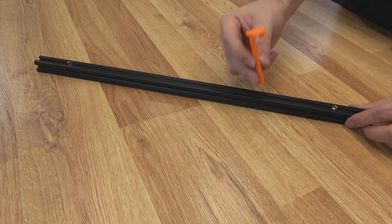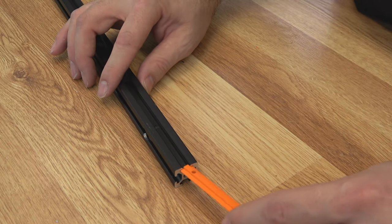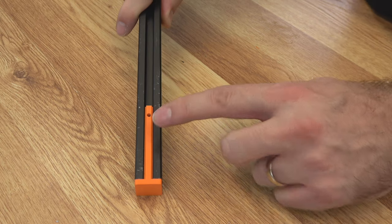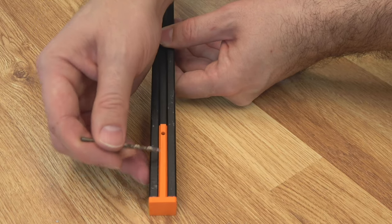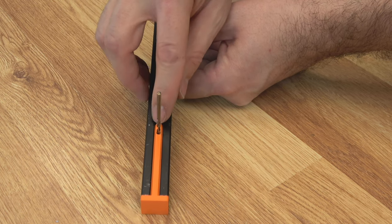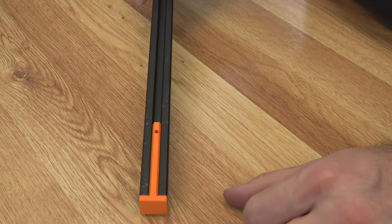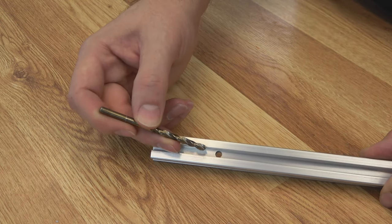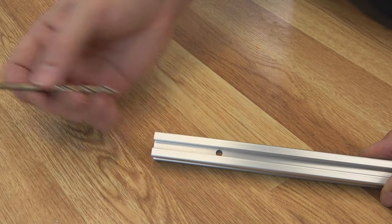Here's the process I would go through to get these holes drilled. You can use the jig, slide it into your extrusion, and that's going to give you the spot that you need to drill. The first thing I would do is drill a 3 millimeter hole all the way through — just drill it with the jig in place. You might want to print out a couple of these just to make sure they're the right size after you drill them. Then after the 3 millimeter, I would move up to a 5 millimeter. That 3 millimeter hole is going to be a guide for the 5, so it gets you up to a 5 millimeter hole.